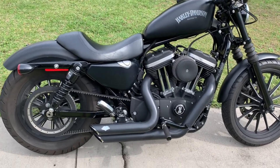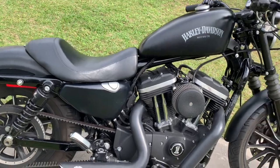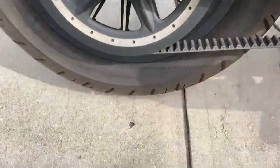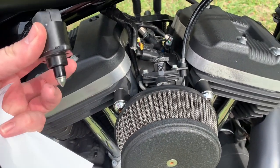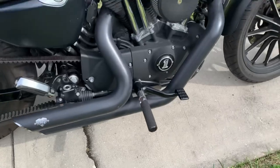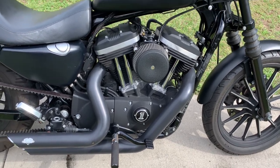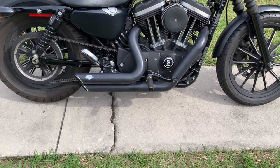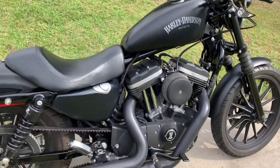In this video I'm discussing the manual idle air control valve. This is the manual idle air control valve that replaces the factory idle air control valve — a single plug with a plunger that goes in and out, controlling how much air goes into your engine. As far as I can tell, they use the same unit for Sportsters, both 883 and 1200, from 2007 up to 2020, 2000 to 2005 Dyna and Softail, and 2002 to 2017 V-Rod.